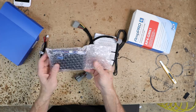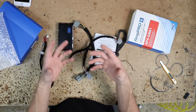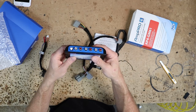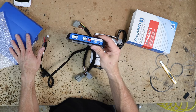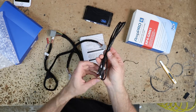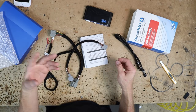One of the key features of AmpPro is that it allows you to keep the factory amplifier while adding a secondary amplifier. If you just want to add a subwoofer, no problem — let the factory amp play all the other speakers. Each AmpPro has a six-channel five-volt preamp output. This one also adds a Toslink digital connection. On the other side are dip switches — the secret dip switch for this case is number three: it's not in the instruction manual, but flicking number three sums the FM, AM, and satellite over to that channel. It also comes with a T-harness and a bass knob.